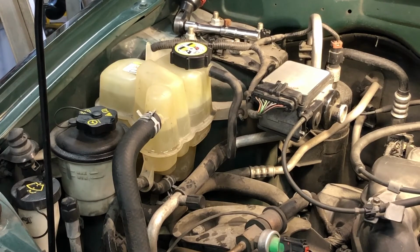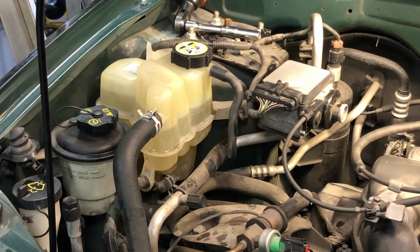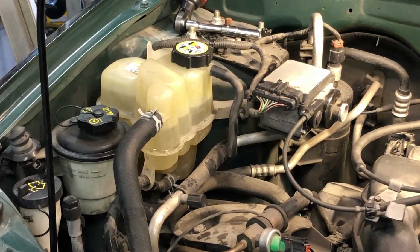All right, so I've shut the vehicle off. We're just going to let it sit. We're going to let it rest. As you might notice here, the coolant level is still above the cold mark. I'm going to go ahead and leave it at that level, as this vehicle cycles, it has heat cycles, you know, it gets driven, cools down overnight, gets driven again, it'll burp a little bit more. You get tiny little air bubbles out of it. So it's a good idea to just keep it a little bit overfilled. Maybe that's a little more than I normally go, but that's okay.